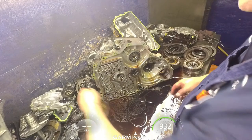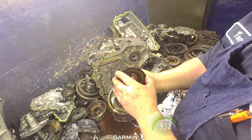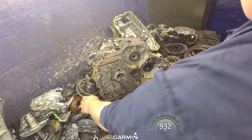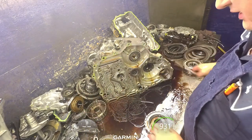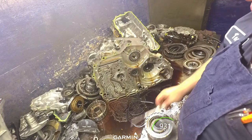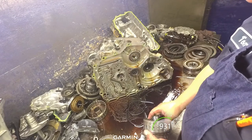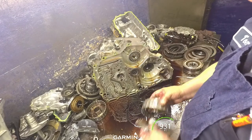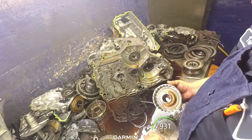Some kits come with a balanced piston, some don't, so if you want them, you need to make sure and order them. All right, I don't have to worry about marking this drum because this is the only other drum on that shaft and it looks like this. So I'm going to know that this stuff goes with that because it's the only other one with a balanced piston.